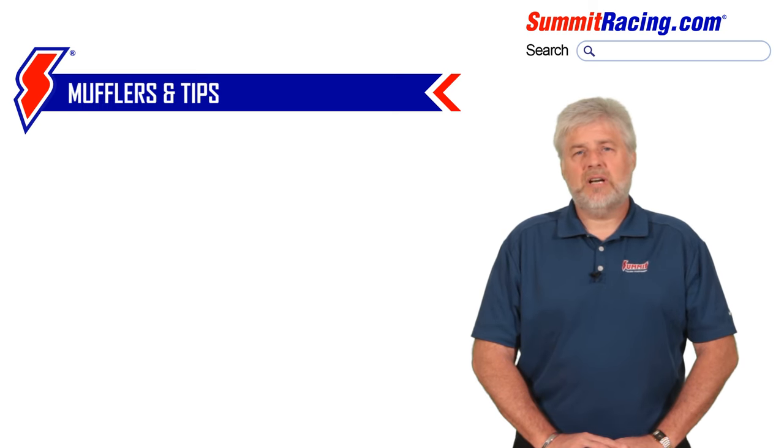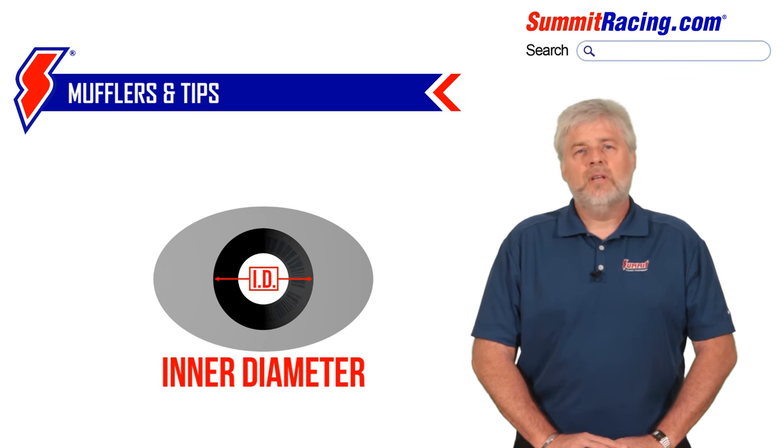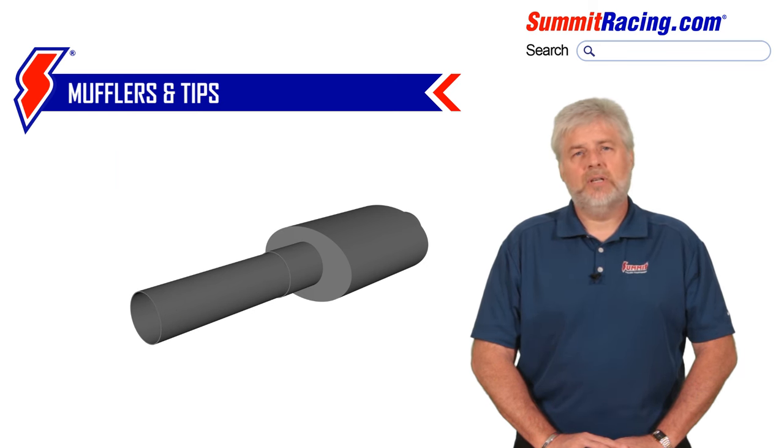Next, we'll talk about mufflers and exhaust tips. These components are normally measured in ID dimensions, which stands for inner diameter. These components are designed to form what's known as a lap joint. So when you see a 3-inch muffler and a 3-inch exhaust pipe advertised, this means the pipe will slide into the muffler opening. The lap joint is probably the easiest connection to deal with, because it can be secured using a saddle clamp or the proper band clamp. You can also just weld the seam between the two components for a 100% leak-free seal.